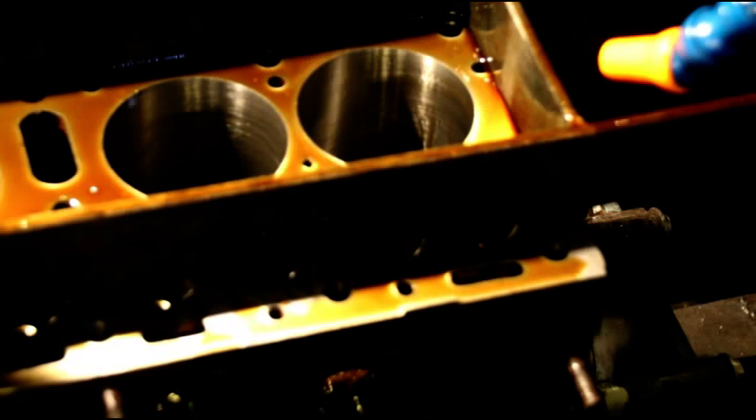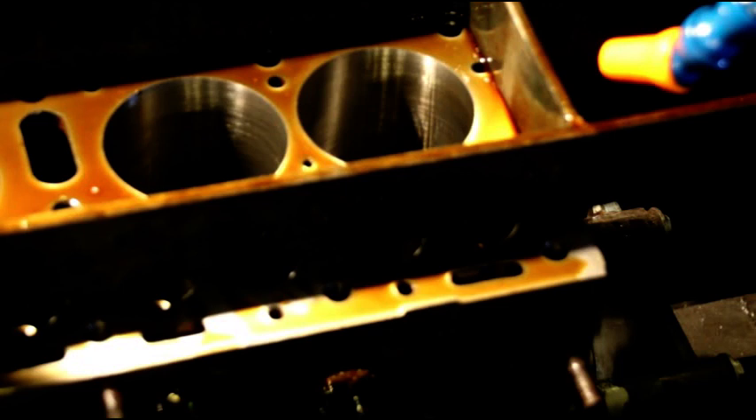We are right at zero - right at size. The other pistons were a little snug, so we might have to go a little over size. But each piston will be fit to its hole, and that way we'll know we're going to make the most power out of this engine. I know this engine was kind of dragging for you, Lou, but you'll be surprised when you get in it again when it's all finished. I've got three more holes to fine tune and we'll get busy on that now.